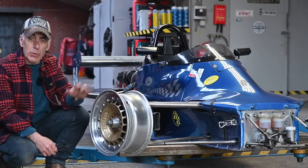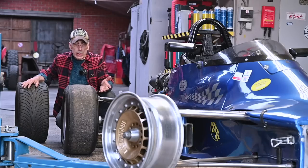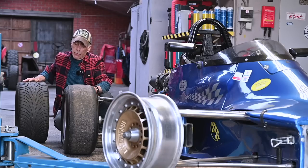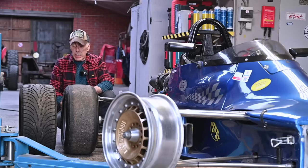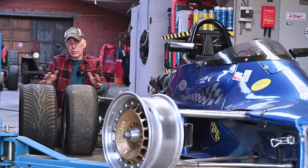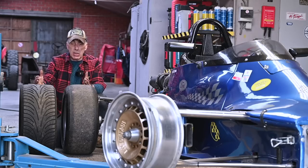You've probably noticed that I have no tires on my front rims — there's a good reason for that. If the weather is dry, we're going to race with slicks, but if it's wet or rainy, I have to use my rain tires. So I need to have a set of both available and take them to the track. I'm now preparing my rain tires as well — having them balanced and checked, making sure the rims are good, nothing bent, nicely balanced, and the tires can keep their pressure.